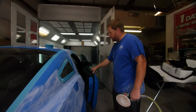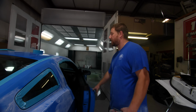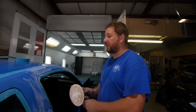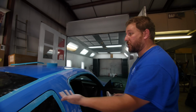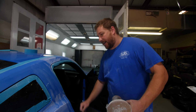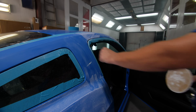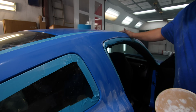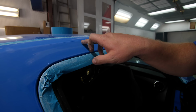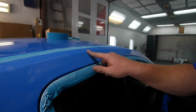If you burn through up on this front edge, you're going to have a color match difference between here and here. So if you are sanding your car for yourself, doing your own paint job, or any kind of repair where you have to wet sand your clear, even if you're wet sanding your clear to polish it back up, to remove some of the orange peel out of a factory paint job, you need to be easy around the edges. That's why I don't spend too much time sanding here. I'll come back and hand sand them so that there are no shiny spots. If you are clearing or painting your panel at your house, shiny spots are a bad thing. Now I've just DA'd this, and that shiny spot would cause an issue where paint's not going to stick to it.